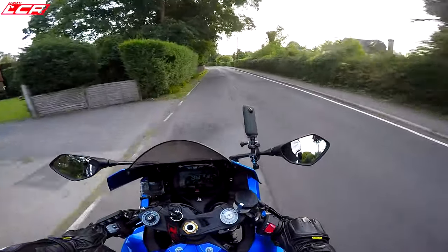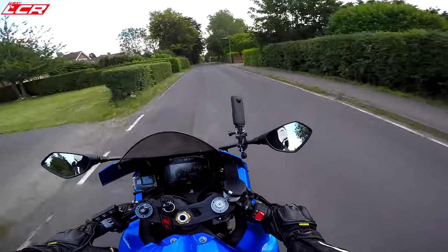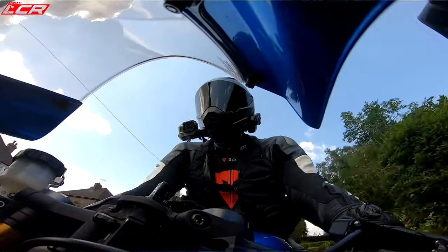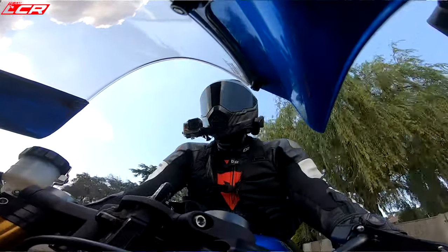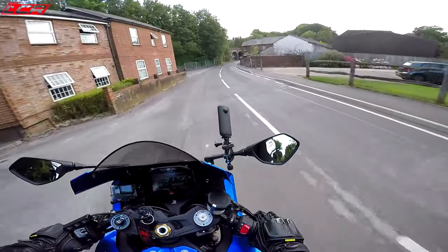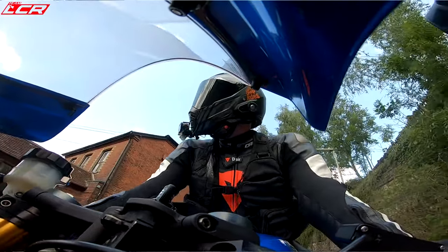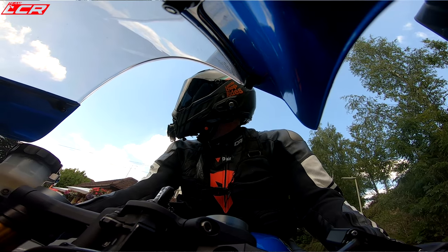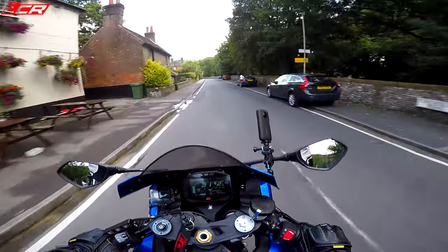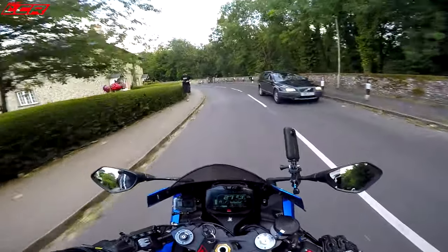I did ride the bike when it just had the map on before the carbon wheels went on, and it was ferocious — smooth but ferociously powerful. Put the Dimags on and my god, these are quite lively at the front — they tend to waggle the bars a little bit. What PB did when this was run as their long-termer with Chris, they raised the front of the bike to calm it down — you get a lot of spare fork tube sticking out on the R model as standard. That calmed things down, it still turns incredibly quickly but stopped the head shaking. Fitting the Dimags has brought that back a little bit — the wheels are so light they lift the front and it can get a little bit exciting.